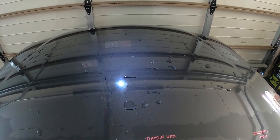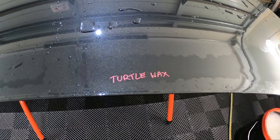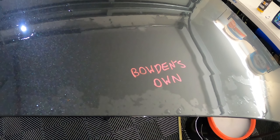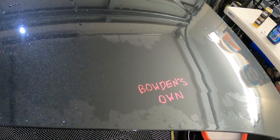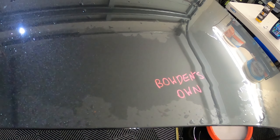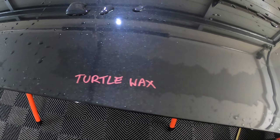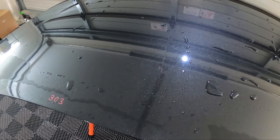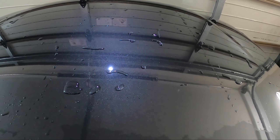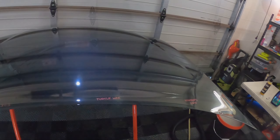That is our sheeting test done. Clearly Bowden's is in first, Turtle Wax second — though starting to fall a fair bit behind. They were kept pretty even for about three weeks. I already knew Bowden's would hold up because we've tested it twice now against other products. The Turtle Wax is new to us, so at the three-week mark when Bowden's looked strong I expected that to continue. Around the one-month to six-week mark is where we start to see it lose a little hydrophobicity, and Turtle Wax unfortunately started dropping a little earlier. The 303 and Ethos were never in the same league after the two-week mark. Now let's blow off the remaining water, dry it, and switch to a mist to check beading.